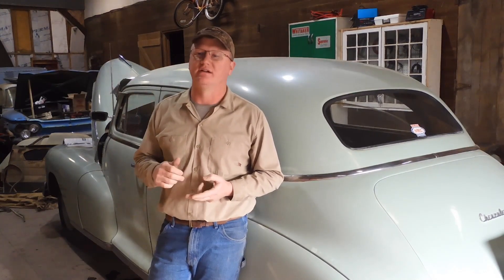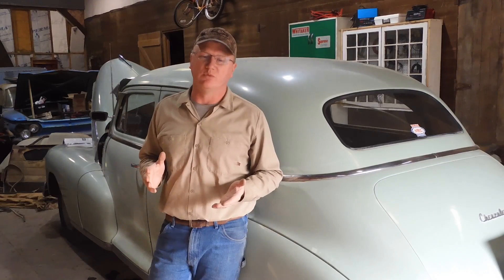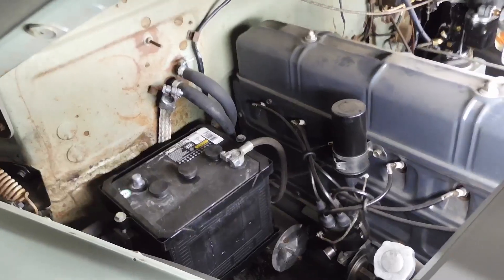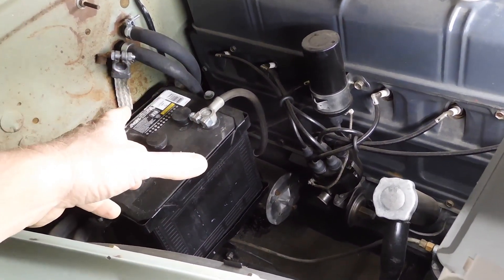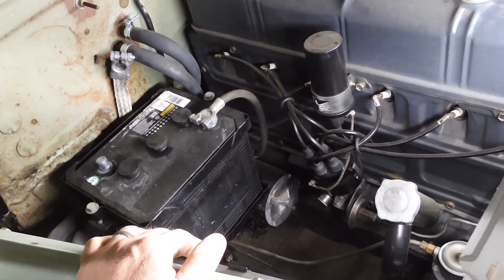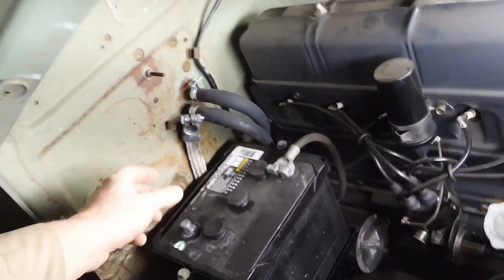The big one you need to consider is battery cables. If you have plastic-coated cables — if there's any red plastic showing under the hood of your 6-volt car, get it off of there. Unless you can actually find a 1-0 battery cable with red plastic sheathing, it's not big enough. Let me show you the battery cables on this thing. There's my positive battery cable going down to the starter. Underneath the outer insulation, that thing is better than a half inch in diameter. That is a 1-0 battery cable — you have got to have at least that much.